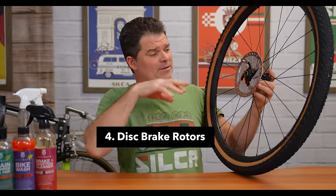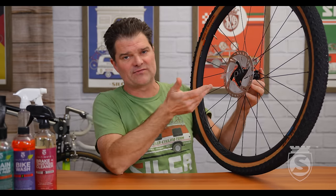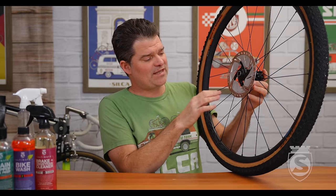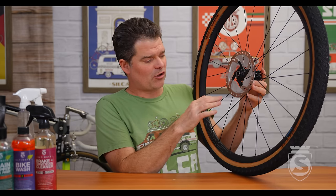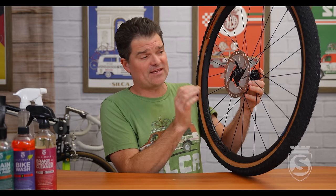Number four: rotors. This is something we didn't have to think about 20 years ago, and now all of us have disc brakes everywhere. Squeaking, squealing, and noise from disc brakes almost always comes from some sort of oil or grease getting on there and contaminating the pad. The key to solving this: don't touch it and don't let anything oily or greasy touch it. This is why we say no aerosol lubricants on the bike — spraying an aerosol lubricant on your chain with the disc brake just five or six centimeters away is a huge contamination risk.